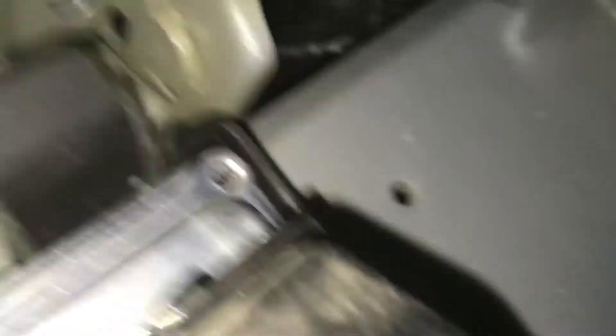I release these tabs by just pushing up on them, and that releases the TCM. I unlock the red tab going upward and push this little thing right here, lift the tab up, and out comes the plug of the TCM. This is the new TCM — I just put in the new unlocked ZZP TCM, and my old original computer is right here: the one I just removed from my 2018 Cadillac ATS turbo.